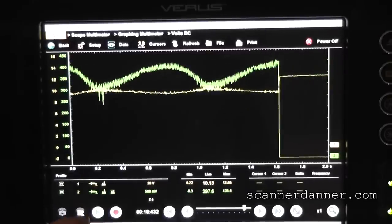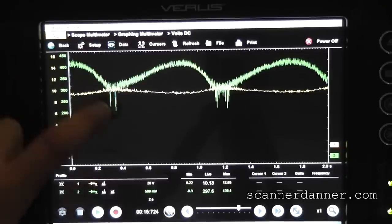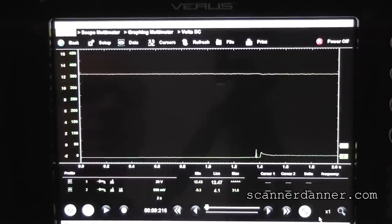I'm reading between 300 and 400 amp surges on this starter — a huge amount of current flow. But when you have this kind of amperage, it confirms your battery is fine, your starter is fine, your cables are fine. There is something mechanical going on here. Next, we're going to pull all four spark plugs out and listen to the way it cranks with the spark plugs removed.